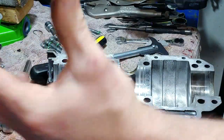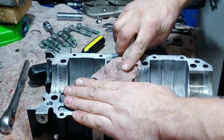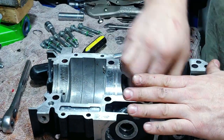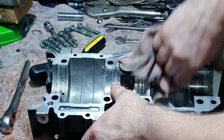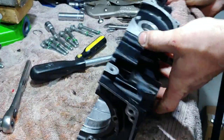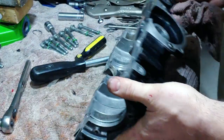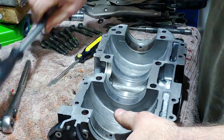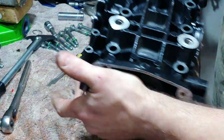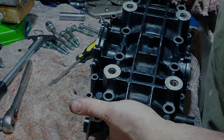I think it's about four and a half foot pounds torque on that. But it's going to get replaced. I figured I'm going to go ahead and tear this thing down and make sure I'm covering all my bases. I've put this much work into this sled so far, I don't want to cut any corners. So I'm going to go ahead and degrease these, tape them, blast them, cook any impurities out, and then coat them.